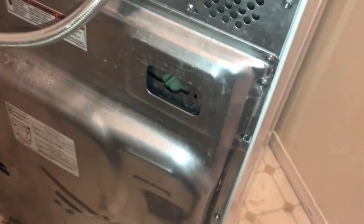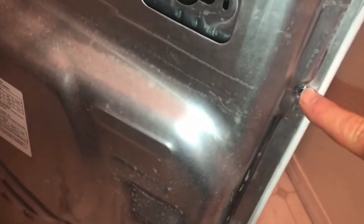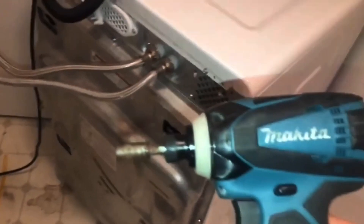To access the back drain, we're going to want to take this back panel off. All of these are quarter-inch bits — one, two, three. They'll work with a Phillips screwdriver too. I'm going to use a drill with a quarter-inch bit — it makes it so much faster and easier. There's about a dozen of them that go all the way around, and don't forget there's one right here in the middle — you've got to get that one out as well.